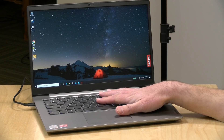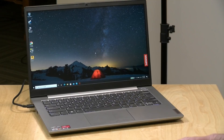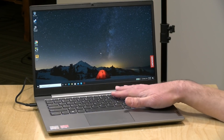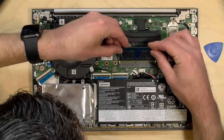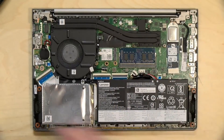This computer has a Ryzen 5 4500U processor inside from AMD. This is an exceptionally well-performing chip that we're finding in a lot of lower-priced computers lately. It does very well with graphical tasks like photo editing and light video editing, and it even does a really nice job playing games. But these chips need to have the computer's memory configured the right way. The default configuration for this machine is 8 gigabytes of RAM in a single-channel configuration with the memory soldered onto the motherboard. However, there is another RAM slot that you can populate, and we added another 8 gigabytes of RAM, which dramatically increased its performance, putting it up to the level that all the other Ryzen-based machines we've looked at have performed.